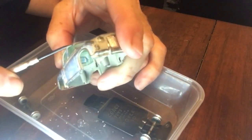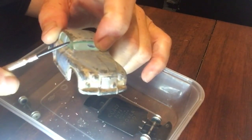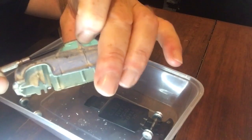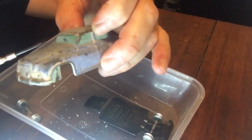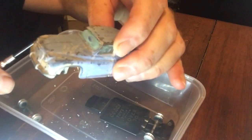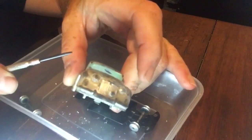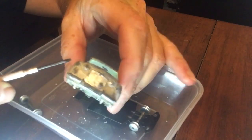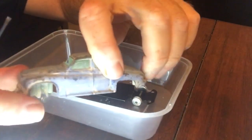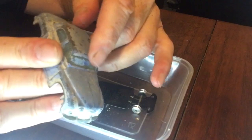So, A pillar missing, and whatever broke the A pillar has cracked the clear part of the glass there. The cracked A pillar there, that'll be savable. There might even be a small crack in the roof here, but that's not too difficult. Obviously the roof is a little bit depressed. It's a bit sad on this corner. So it'll have to come up. So we'll have to replace this A pillar and just reattach that one. The rest of the car is okay, it's fine.